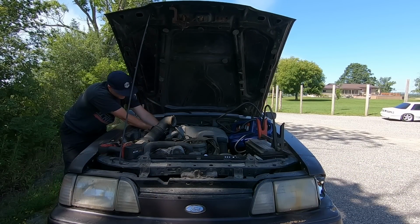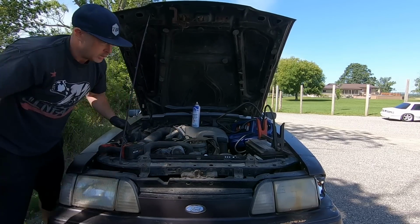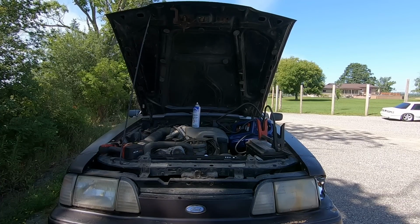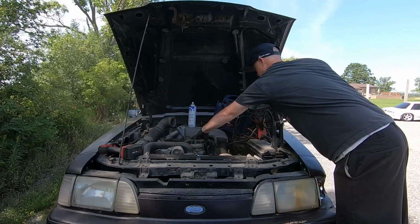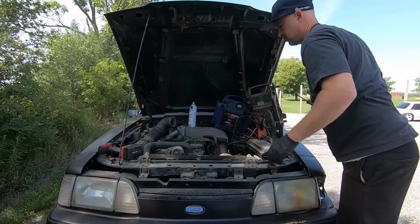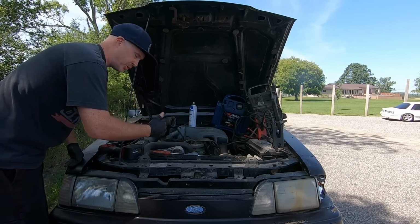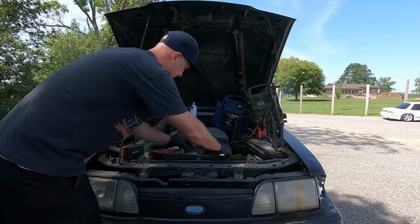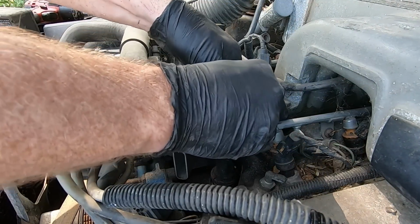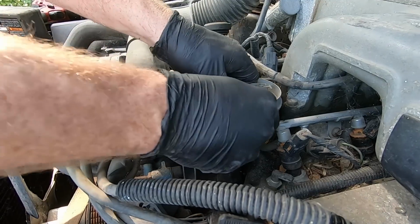And we'll get some brake clean in this thing. Success. I must have had that distributor off one tooth. I kind of felt like when I was putting that distributor in that the rotor went over one spot extra, and sure enough, I moved that distributor and this thing fired up. Over to the side. I feel like that's where it was. That's where it was.